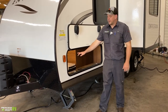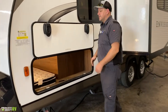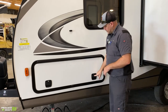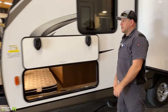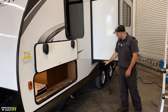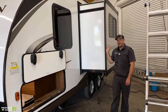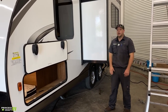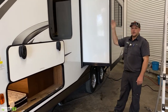Inside the pass-through storage there's a push-button light on the face to turn it on and off. The doors have slam latches — one with no key and one lockable — and are held open with a magnet. On the slide, this is equipped with a Schwintek slide system. You can see two slide tracks on the side and two on the back. These need to be lubricated periodically with a Teflon-based slide lubricant — make sure they're clean, spray the lube on, then run the slide in and out a couple of times to transfer it to the gears in the wall.